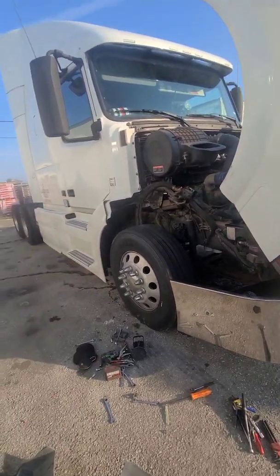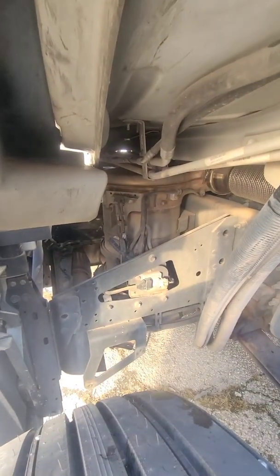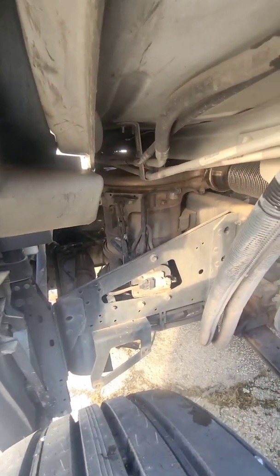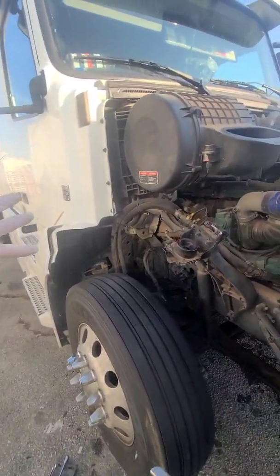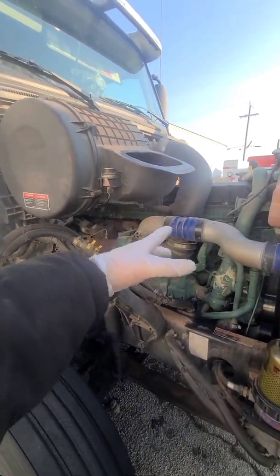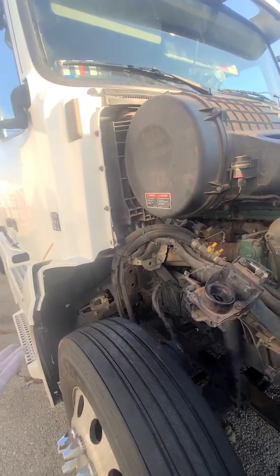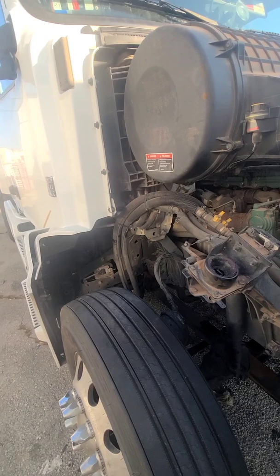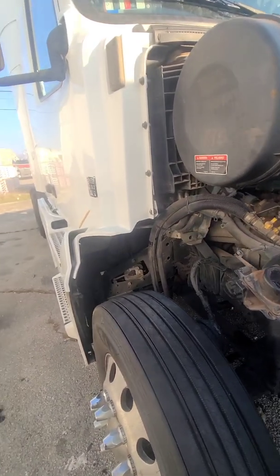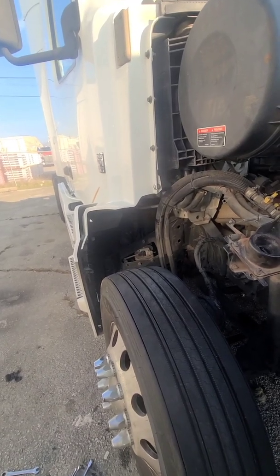I've been running into issues with different customers. Their DPF filter is not being properly deleted. You have to cut a hole through the filter so that it doesn't get clogged up and then start pushing oil out through your turbo, into your air filter, and messing up your whole system. And then it'll show that your soot level is super high, i.e. the 140 soot level. We only brought them down to 100, which still is not great, but it got them out of D-rate.